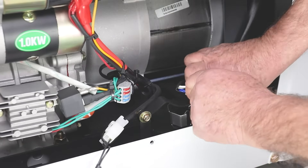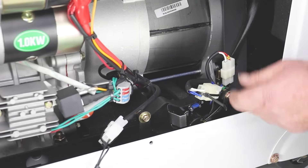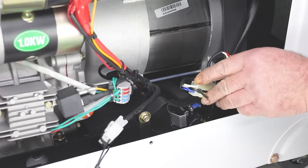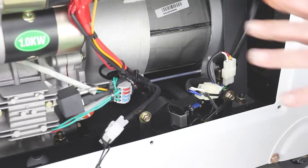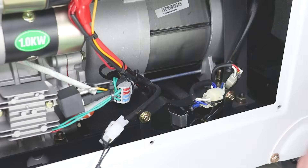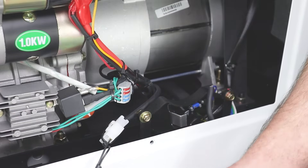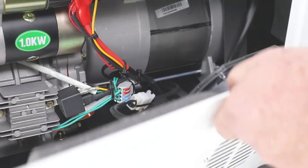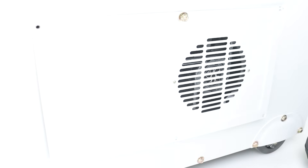It's worth noting that occasionally when pushing the two halves of the plug together it can push one of the little connectors out of the back of the plug. If you can see the brass connector sticking out the back, just get a small screwdriver and push it back in until you hear it click — it doesn't happen often but it can happen. Cut off the excess cable tie and tuck those connectors back down out of the way. Then refit one bolt in the top first so it's secure, making sure the wire isn't hanging out, and replace all six bolts.